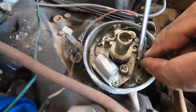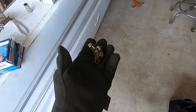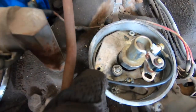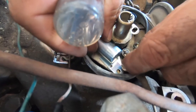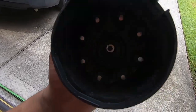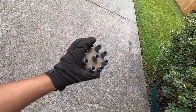Be very, very careful. Old one out — honestly, these points are not that bad. Out with the old and in with the new. We just took off the condenser for a better look — cheap parts check, major concentration. I lied, those points are pretty bad. These new ones are really clean; glad we're doing this. It's so hot and humid, but we now have the distributor cap out.